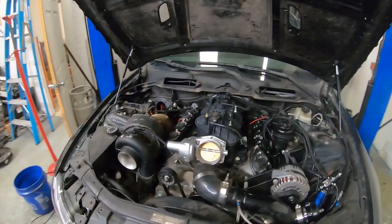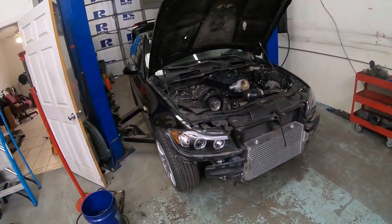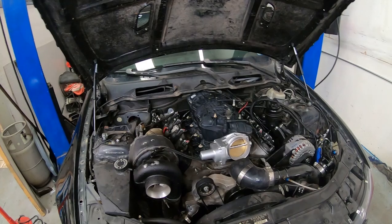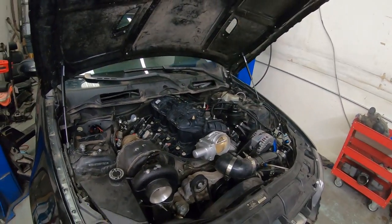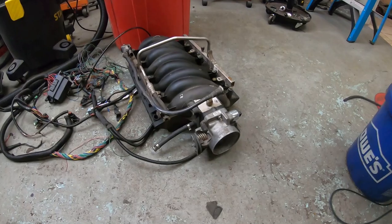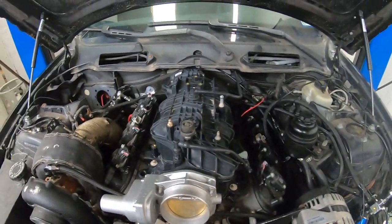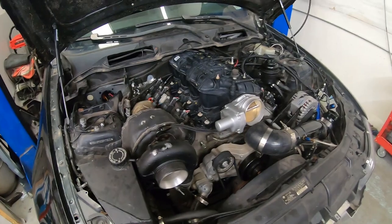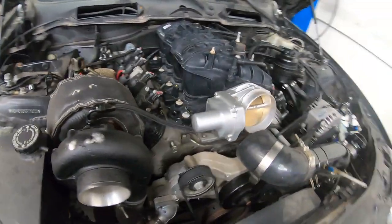With the LS sitting in your BMW and the Holley kit ready to wire in, if you know what you're doing this should take no more than an hour or two to get running, then another hour or two to clean everything up. The wiring should not be the daunting part of this swap. I already pulled off the MS3 and swapped intake manifolds — I had a drive-by-cable LS1 setup previously, so I went to a four-bolt manifold. This is a Trailblazer SS / new body style intake — still a cathedral port, four-bolt style — and I have an LS3 gold blade throttle body on it with a six-pin connector.